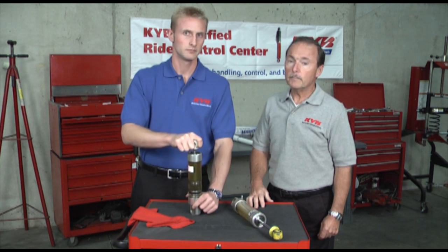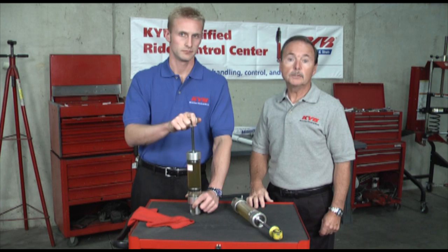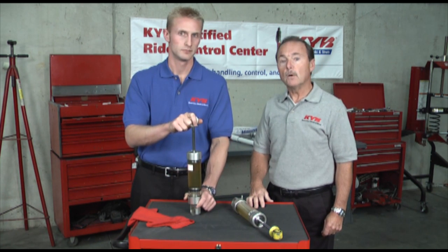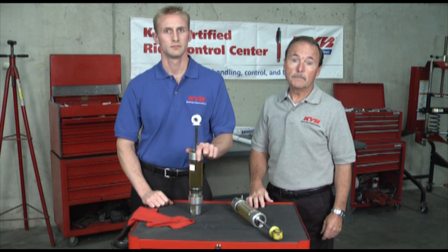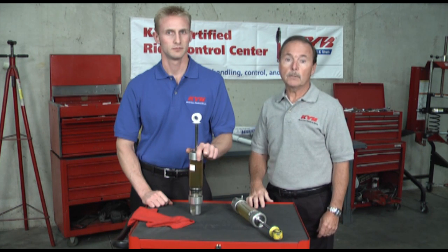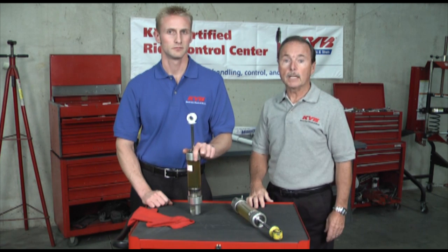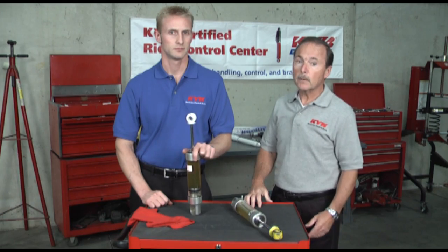So that's the monotube. It provides more responsive vehicle control, additional vehicle stability and less body roll. Did you know that in some vehicles they come factory equipped with a monotube? The KYB Gas Adjust is the right replacement monotube for those vehicles. But since most vehicles come equipped with a twin tube design, the Gas Adjust and the Monomax, which are both a monotube design, become a performance upgrade.